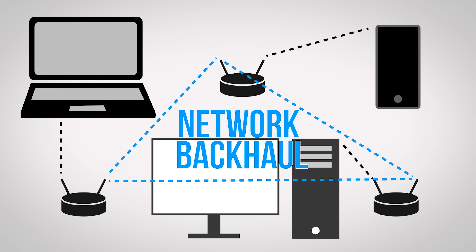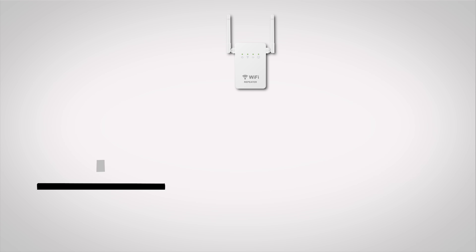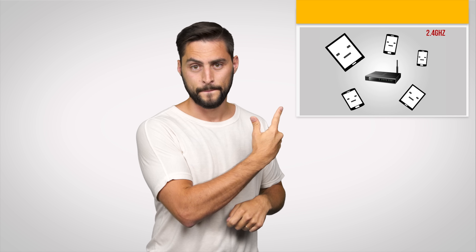This helps them handle network backhaul — all the traffic other than what's being transmitted to and from the device in your hand. Although this isn't a perfect system and mesh networks can still slow down if you add lots of nodes, they do tend to be much quicker than simple range extenders. These days you can get fancy network extenders with multiple antennas and even models that support MU-MIMO, which lets the extender send and receive from multiple devices simultaneously. So are there still benefits to going with a mesh network instead?